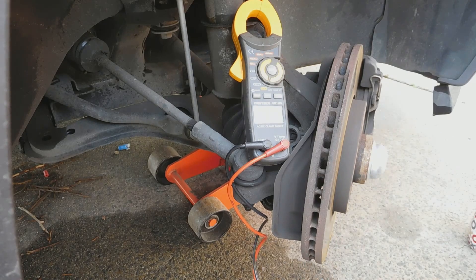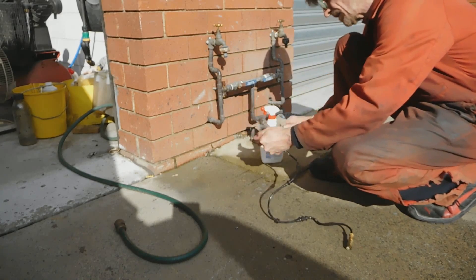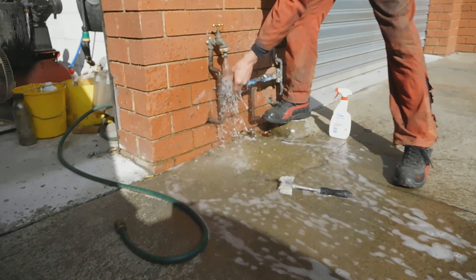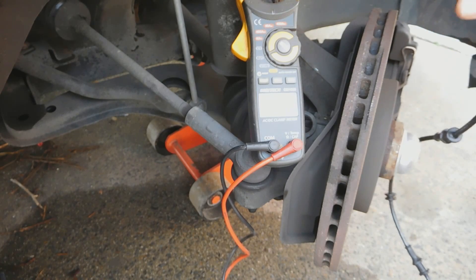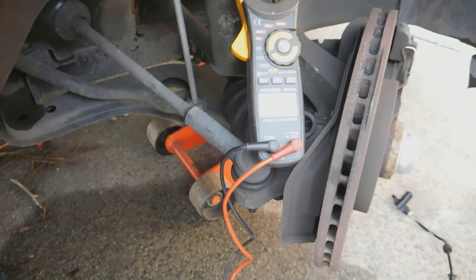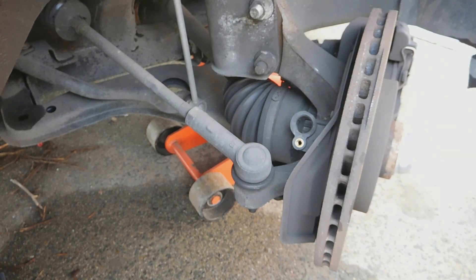If it's that crap on the end that's causing this, I'm going to clean the other one too. After getting the muck off, the ohms reading is 1.47K — now that's within our specification. I'm going to put that back in and test it. I'll take the other wheel off too, get a little toothbrush in there and clean the end of that sensor — hit it with the hose, spray cleaner, and just clean all the muck off around it.